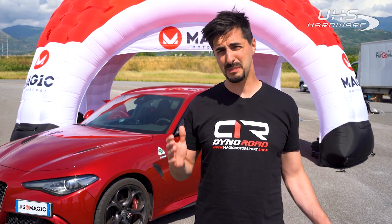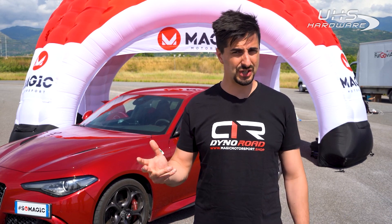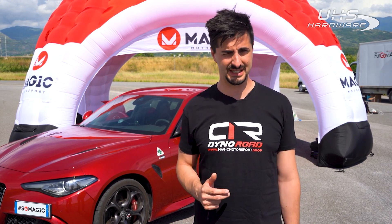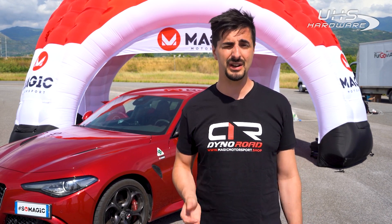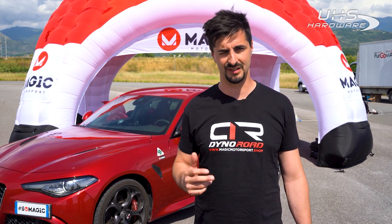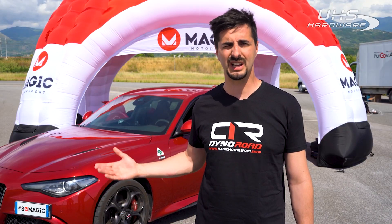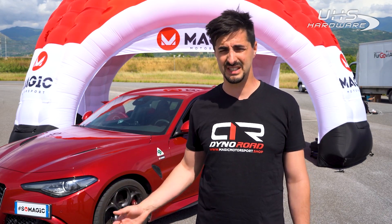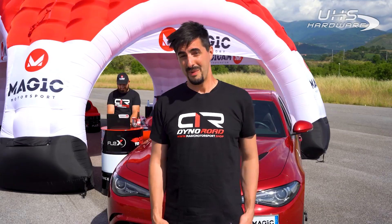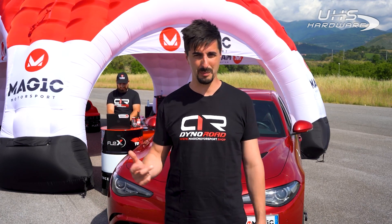The vehicle also needs to be set in dyno mode. What's a dyno mode? It's a special mode used to test the car on the dyno — otherwise the traction control system and other stability systems will change the results. Sometimes it's easy to set up, but in some cases you need an official diagnostic tool. This Giulia, for example, has accelerometers and gyroscopes that will cut the power if she's not moving. So when dyno mode is activated, these systems are bypassed. But today we won't be doing any of that — we have an easy and affordable method to measure power and performance without the hassle.